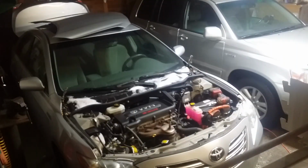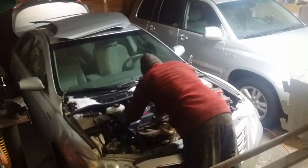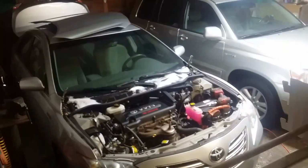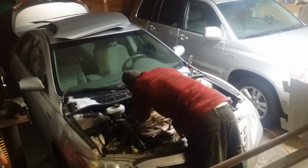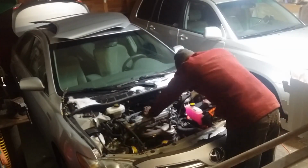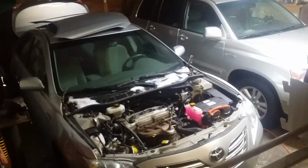Once the hood is off, we go to the trunk and disconnect the regular battery as well as the hybrid battery pack. Once we do this, the rest of the job is just like any other modern vehicle. Nothing involving the hybrid electric system needs to be touched. There's no reason to feel intimidated by vehicles like this. No special tools are required, and nothing needs to be reprogrammed.